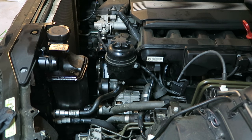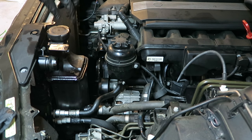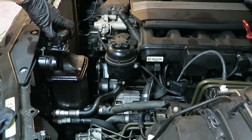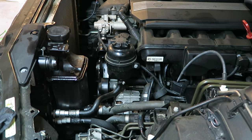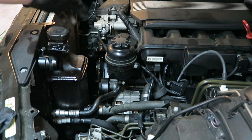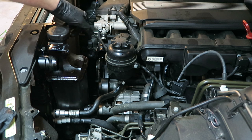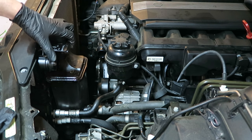I just want to mention, you don't necessarily need to open up the cooling system here. However, this expansion tank also has a crack in it, so I'm going to be replacing a couple other things not covered in this video, such as the upper and lower radiator hoses, the radiator, and the expansion tank. In my opinion, removing that upper radiator hose is worth the effort because it makes it easier to reach the pulley, and you're going to need to access that in a moment when we remove the serpentine belt off of the alternator.